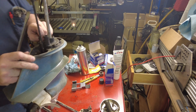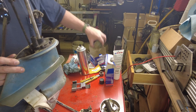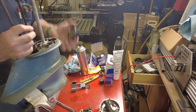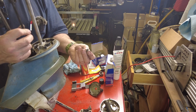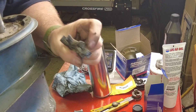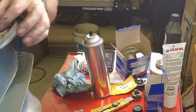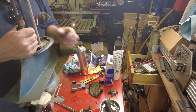We'll take these four screws out of the water pump. The water pump has definitely seen better days — it's missing one of its fins, and it is most definitely holding a shape. You can see how badly cracked it is. Basically, if we had not replaced the water pump and put this motor back in service, it would not likely have lasted long. That's the pin for the water pump impeller — make sure we don't lose that.